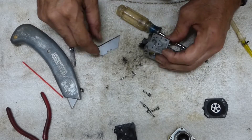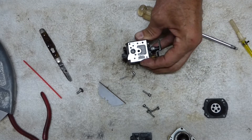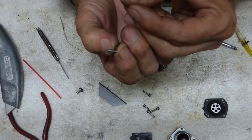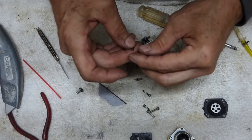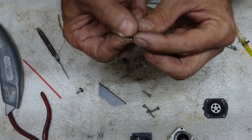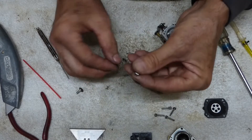Put the screen back in — make sure that's clean. It looks good; the lip side goes up and it just press fits in there. I think we've got everything cleaned up, now we can put her back together. You want to check your needle — this appears to be a rubber-tipped needle. If you've got a rubber tip needle, some are metal tipped and then you'll have a rubber grommet to seal it off. Make sure it's clean and not damaged. Now here's the trickiest part — there's a dimple on here, and that dimple holds the spring in place.